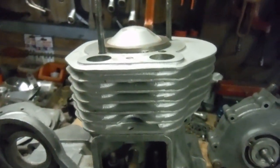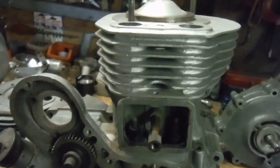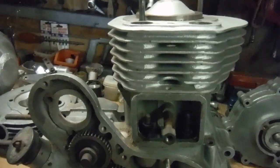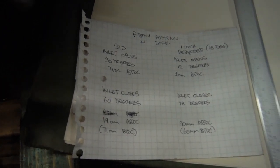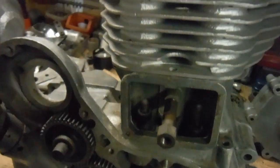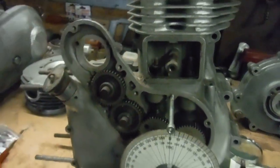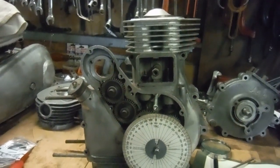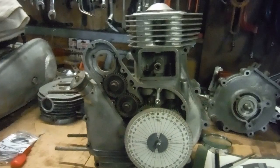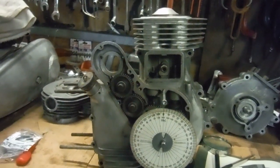If it were a 100 millimeter stroke, every 10 millimeters of stroke would account for 35cc, so we're sort of in that kind of zone. My point here is: when the inlet valve shuts, that is when you actually start to build your working compression. It's got nothing to do with compression ratios — that is the actual physical compression and cylinder pressure you're going to be building up before you reach the sparking and firing point of the engine.